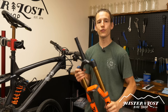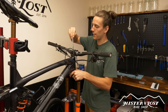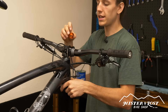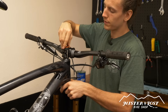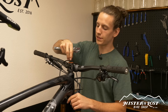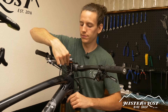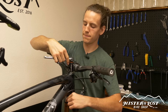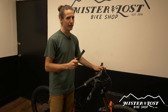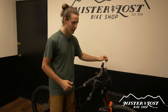Install your freshly tapped fork back into your bike. Add a little bit of grease to the freshly tapped steer tube, reinstall your headset spacers, and then take your EDC top cap and thread it into your fork. A neat feature is that the top cap uses a cassette tool — grab your cassette tool and cinch everything down to about the same tightness as a standard top cap. And now here's the really hard part: you take the EDC tool and you put it in your fork.